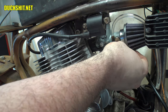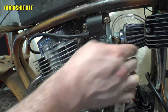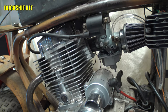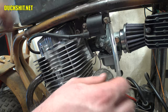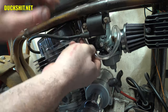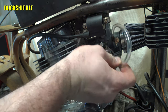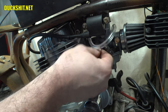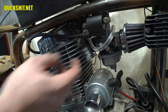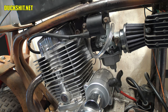Let's throw the air filter back on there too. I'll make sure the hose clamp is accessible from this side of the bike, since that's what's going to clamp the filter down. I'm not going to tighten that down yet because I'll probably find myself undoing it at some point — I've got to get this thing running properly first. Now, where's my outlet on the fuel tank? I need to put a fuel switch in here as well as a filter.